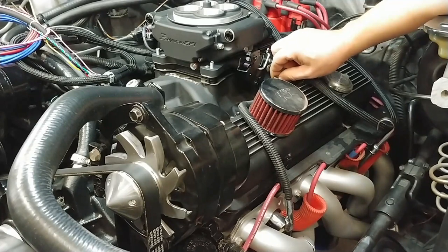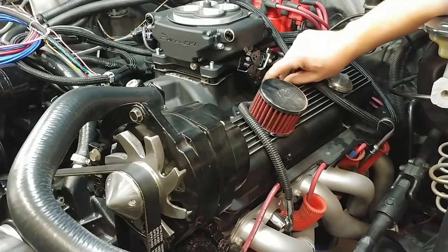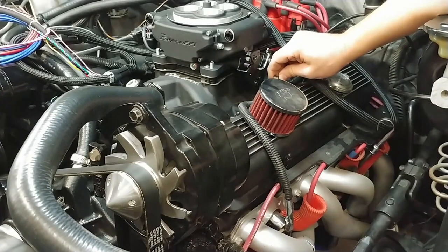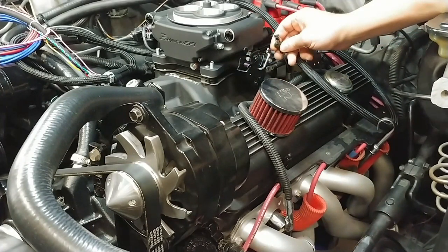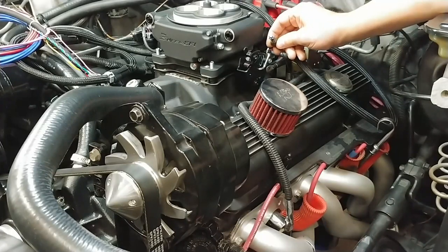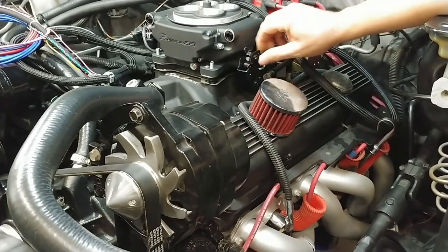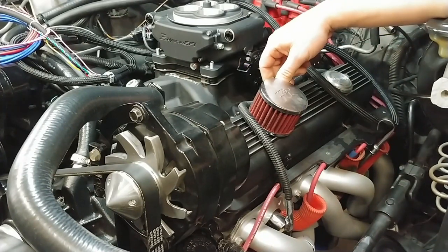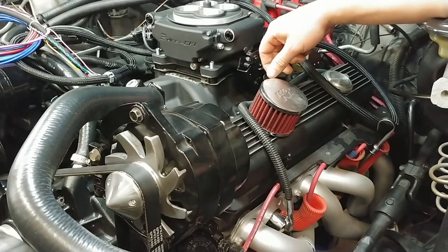But if I position it to where it has just a little bit of travel in it to meet where the stud's going to be, it'll keep it in a safe zone for the proper pressure to go through the transmission, and it won't burn up clutches or whatever else it does. So then, at full throttle, you can see, I don't know if you can see that, you pull it to full throttle and it's got that much give, which will allow the accelerator cable its full travel. So you'll actually get wide open throttle, whereas before on the Street Demon carburetor I was getting about 80% wide open throttle.